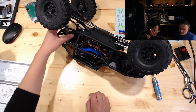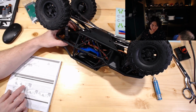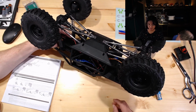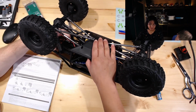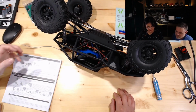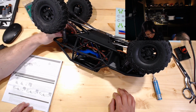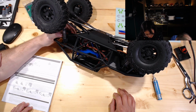Yeah, it's not liking what we're doing. So let's try this again. So we're going to press and hold the set button and then press the on-off button. Okay. Flashing. So now it's flashing. So I've got it neutral, so we should hit the set button. Okay, now we give it gas. Hit the set button.